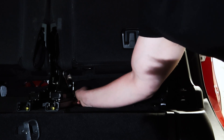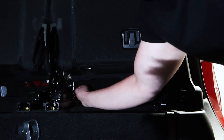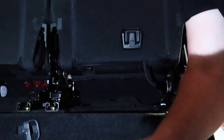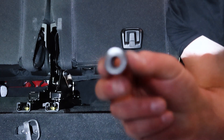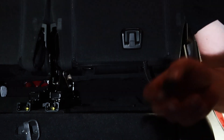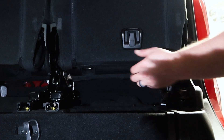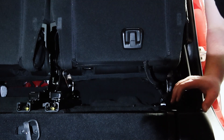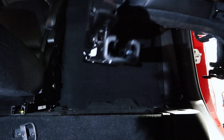I was a little off on my numbers. There's not just two bolts on each side - you also have these two little nuts to get off. There's one massive 18 millimeter bolt you have to take off all the way in the back, then two nuts on each side. So technically it's two bolts and two nuts per side on these seats. One side is unplugged and should just pop out - just got to figure out if anything else is holding it. That was a lot harder than it should have been - oh my god. But we got it out.